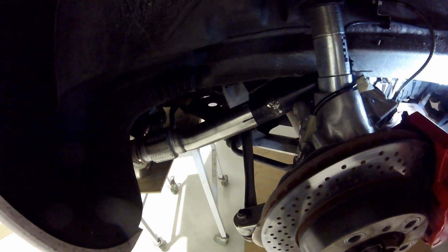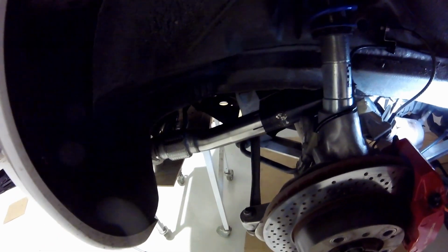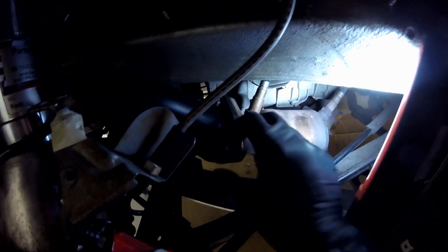So yeah, I'm gonna take it. What I'm gonna do is lower the car and remove these tubes and put on the clamp and some sealant, and then it's out again for the final step. All the bolts in the rear here are finger tight, and I just attach them here so they're still extremely loose. Just wiggle a little bit so all the tension is gone, and then just tighten these, and then do the clamps here. I'm gonna do that on my own, and then on both sides naturally, and then it will come out